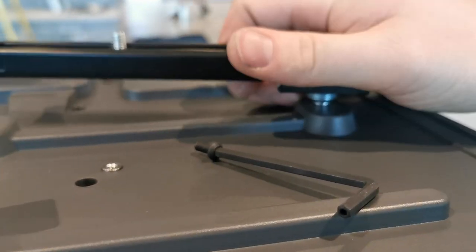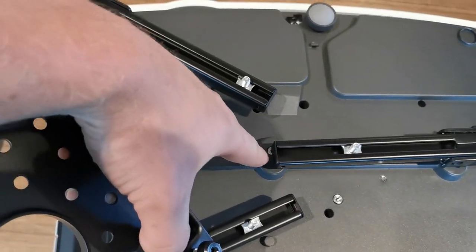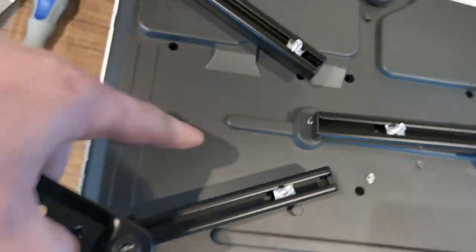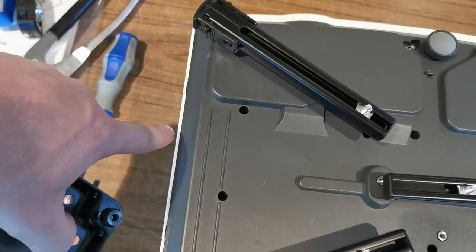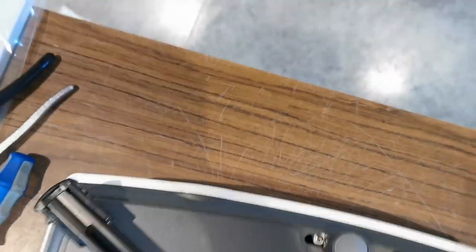Slide it on, locks in, and put in your safety screw. Next, it's really important to figure out where your balance point is. As I found out, this is the central balance point of the entire projector. How you'll figure that out is just grab on different points and see where you can balance it on the sides, and then do it on the front too, especially if you have an off-angle lens.